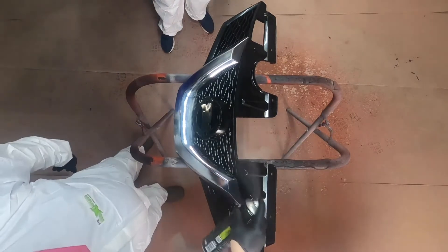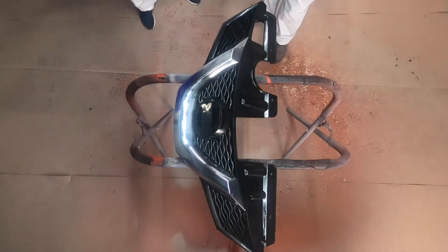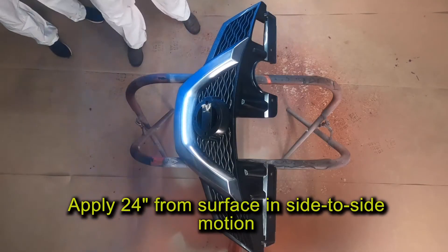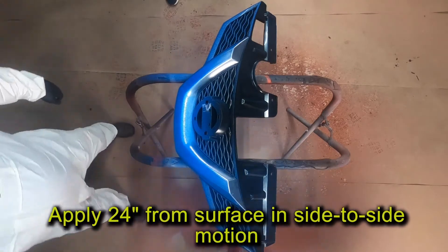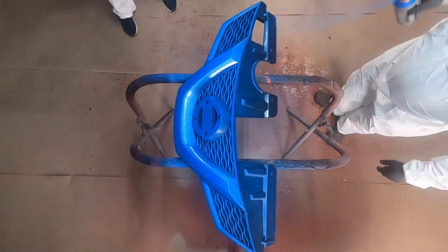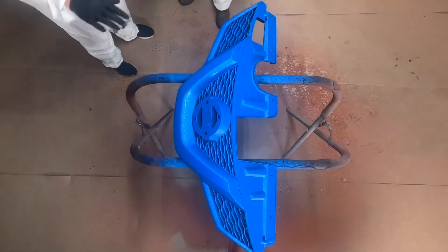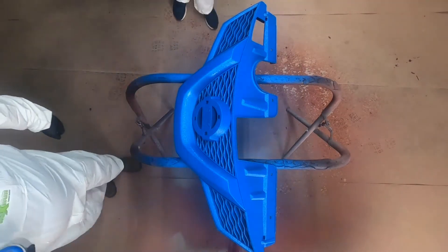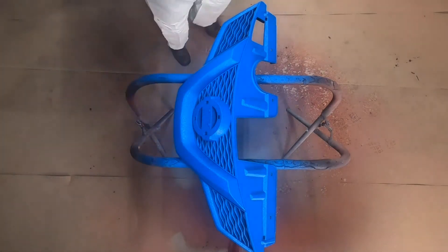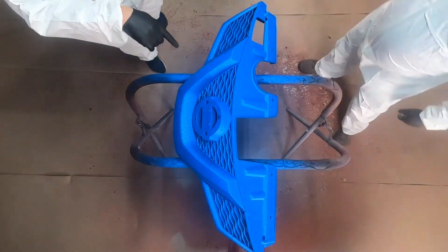Essentially, this is glue for paint. We will now go to the mixing and application process. You'll apply the product from about 24 inches away in a side-to-side swooping motion. It's good to note that two coats are needed for full coverage. Just like our box Raptor quart and gallon kits, Raptor 2K aerosols have industry-leading adhesion, are UV resistant, and highly flexible, which makes them the perfect coating as a bed liner for any machinery or vehicles that require durable finishes.